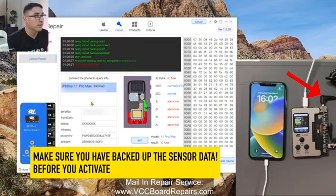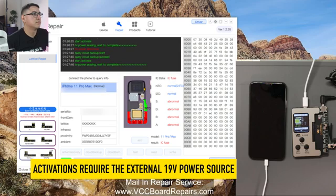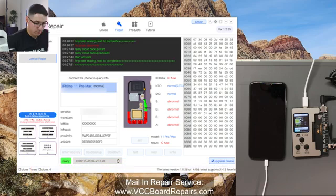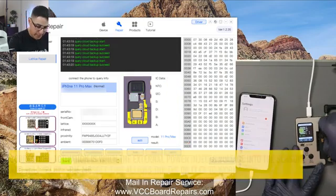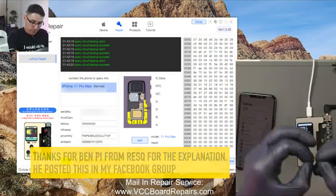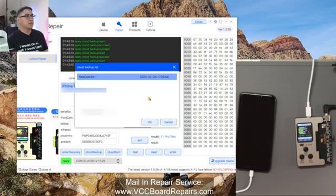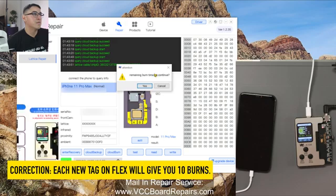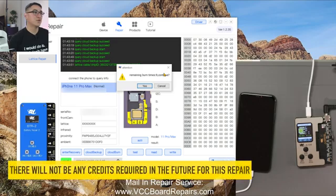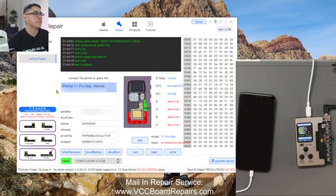I'm going to plug in the power and click Activate. It shows remaining activations — click yes to continue. Now it has done something. We're going to write to the Tag-on flex. Get the little skinny parts sticking out — there's only one way to plug this in. Plug it into the 11 Pro slot. It's detected. Then click Cloud Burn. This part concerns me — I actually recorded this and the video messed up, so I'm redoing it, which is why I now have nine activations but started with ten. I don't know if there will be credits required in the future — I'll post about that in the description. Click yes, and it's complete.